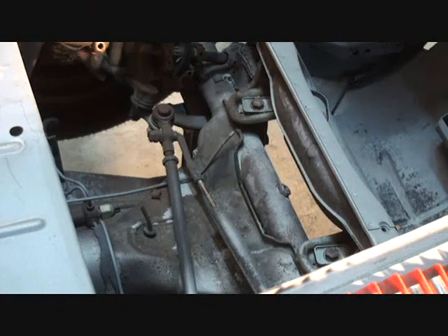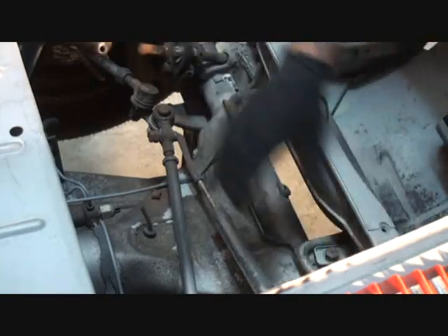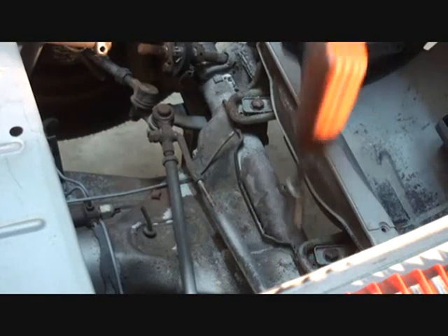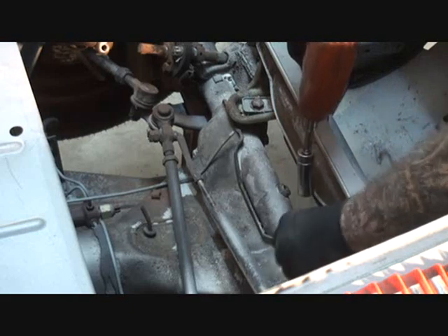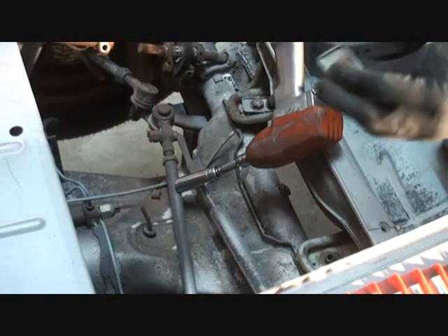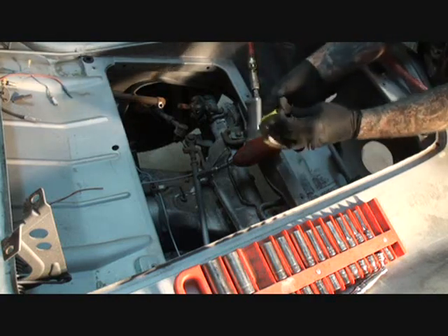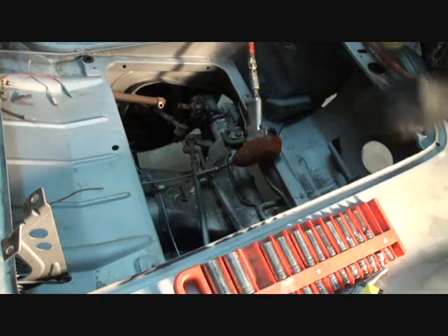While we're in the trunk area, with the steering already loose, I'm going to remove the two front bolts that are bolted to the top of our front suspension I-beam — those are going to be 17 millimeter. I'm going to use an impact; you at home might be using hand tools. These are our front mounting bolts and plates — do not lose those, they are very important. As we're removing bolts, plates, and parts, if there's more than one piece or it's a special nut and bolt, go ahead and put some tape around them so you'll know they go together.